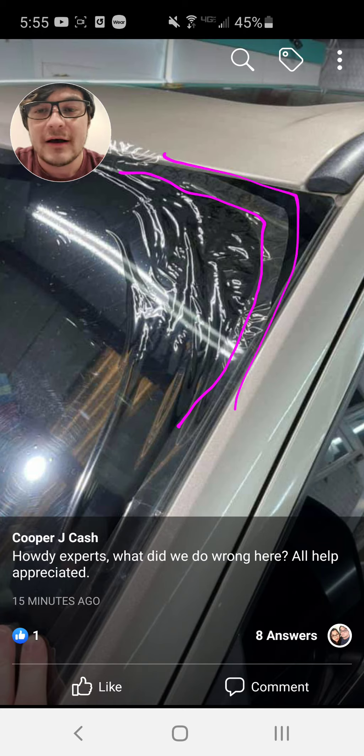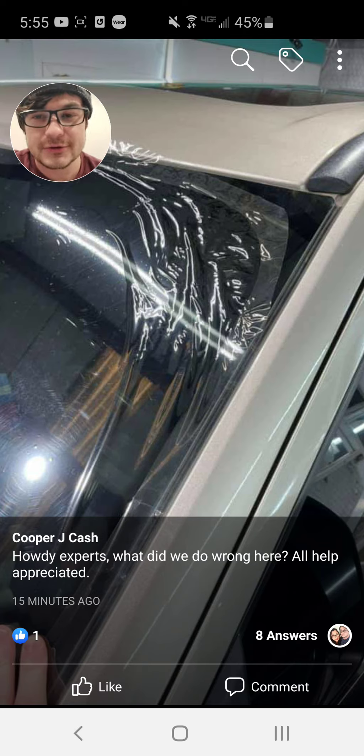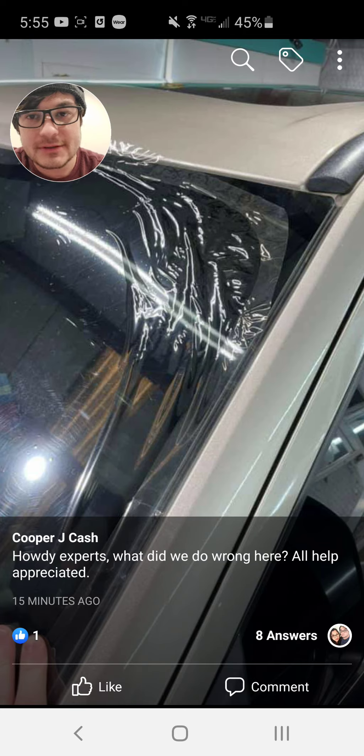Shrinking these is a little more difficult because what we have here is also a plotted pattern, so you have your tint and then you have the extra liner. I would have left the extra liner on while shrinking it, because that plastic liner can definitely curl up towards the edges, making it a little more challenging to shrink. So what happened is right here — we got these lines in this area — it was just over-shrunk.